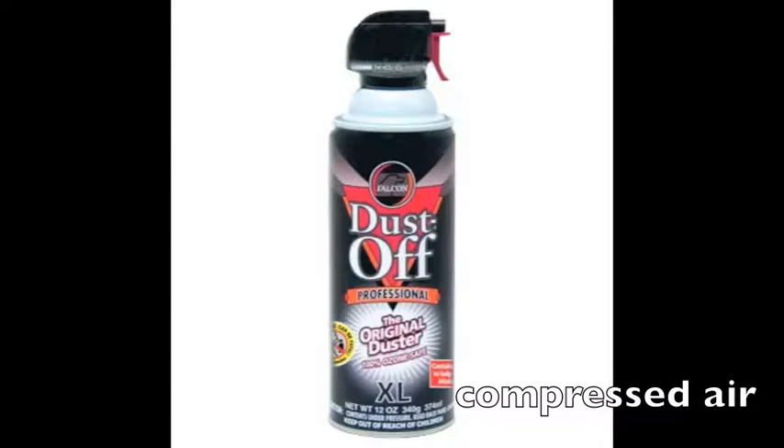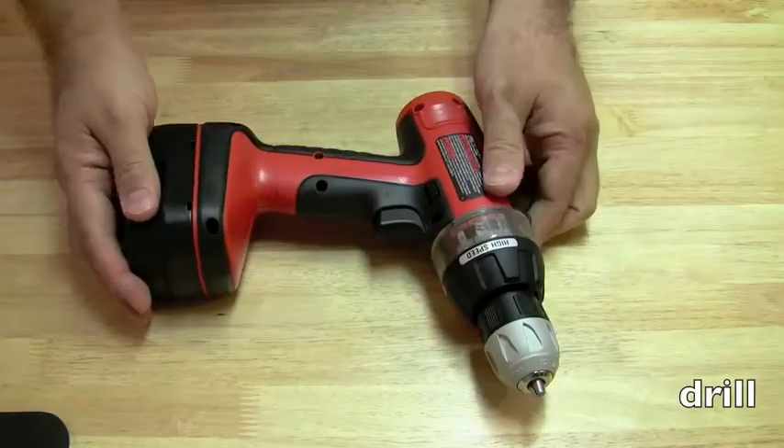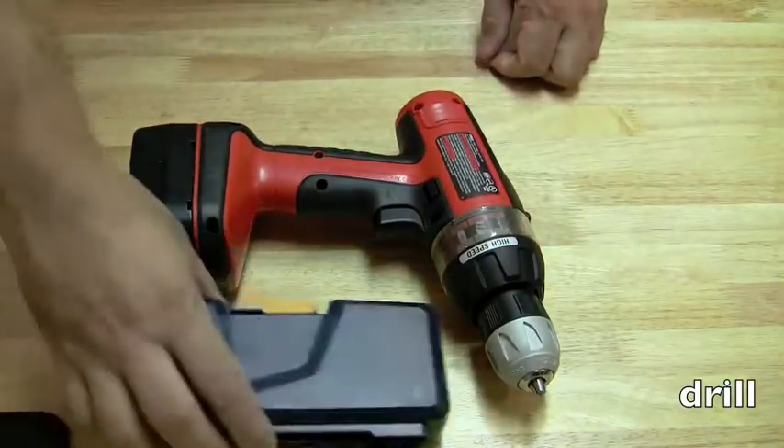Compressed air — if you watch these videos you're going to see that I use compressed air a lot when I'm working on laptops. I use it to clean out dusty areas, blow out the CPU fan to get all the chunks of dust out, and also blow air right through the fins of the heat sink to clean that all out. The only problem with compressed air is it's expensive, so if you're going to use a lot of it I recommend using a blower on a wet dry vac, which I talk about later in this video.